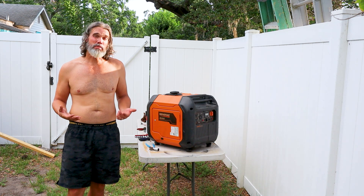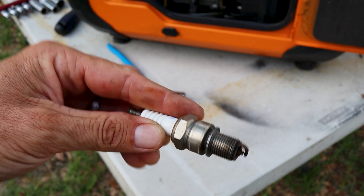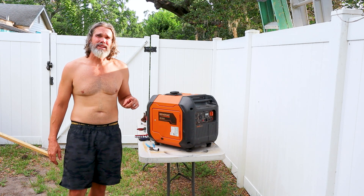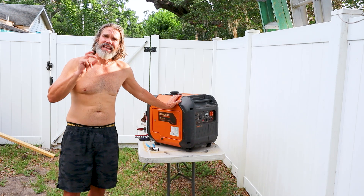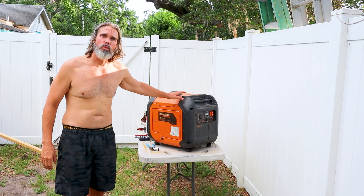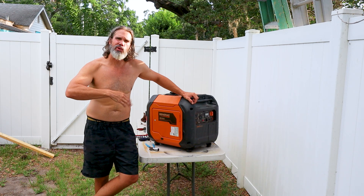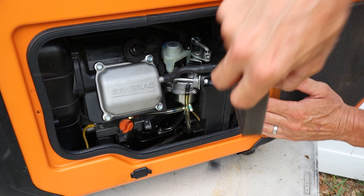Once you feel that the spark plug is at the end of its threads, pull it out. The spark plug doesn't look too bad — I think this thing probably has about 120 hours on that spark plug, maybe even more. It's definitely time to replace it. I also like to keep an extra spark plug handy because the spark plug gaps will tend to widen out if they get worked really hard, so you definitely want to keep an eye on your spark plug gap. With the spark plug out, I just put the little boot for the plug wire back over that hole to keep any dust out, then reach around the side and pop out that air filter to get it cleaned up too.